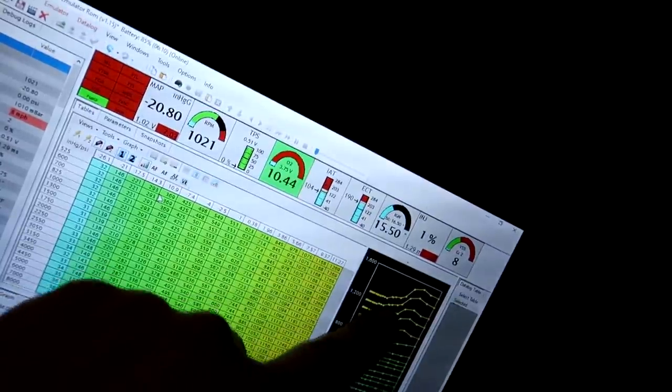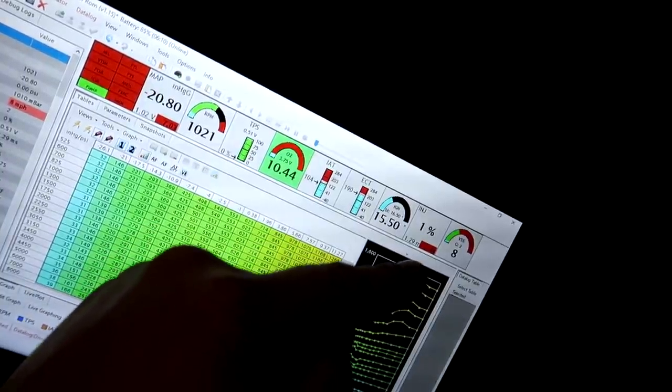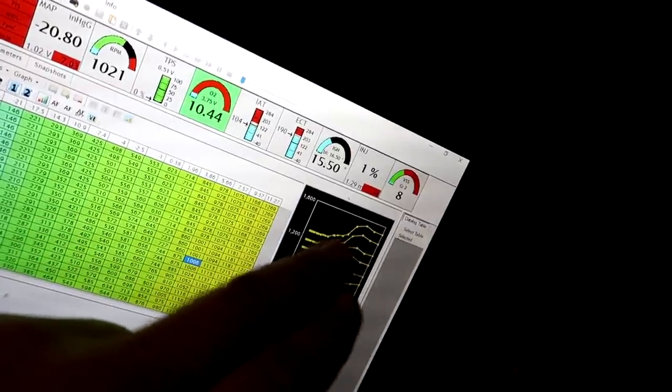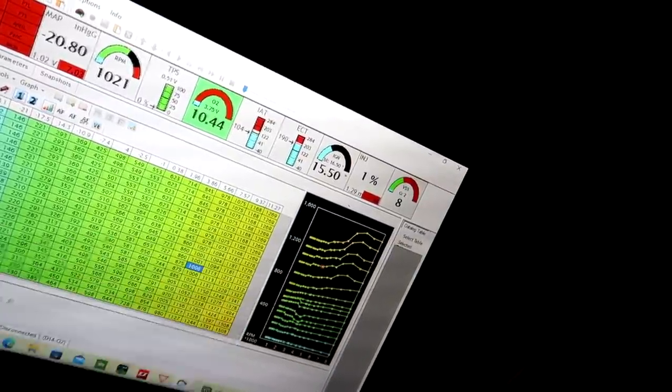But yeah, try to get this torque curve a little smoother. I don't know how I can do that. I'm gonna show you what I did to this fuel change. Now that we have a torque curve to go off of, you can see in the 2D map here that the fuel curve kind of resembles the torque curve. So it's gonna be lower fuel here, more fuel at peak torque, and then level back off, kind of how it's doing right now. Right where this little hump is where peak torque is. That being there just tells us where the peak power is. I had a lean spot where that's bumped up. That's just saying that the car is making more power in those spots, and that's why it's going leaner there. So I had to shape it a little bit differently.